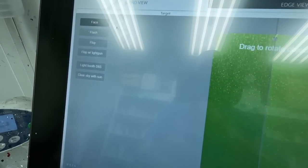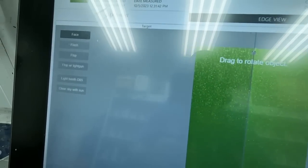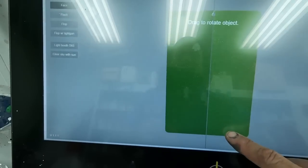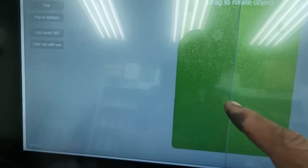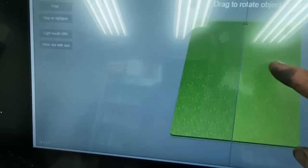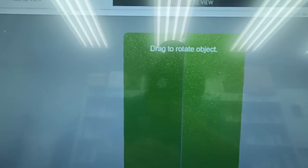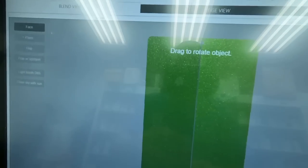So I went over to an area that I know has full coverage on it, and it did pick up PGE. This is it here, and you guys can see now we can turn it, but it's definitely lighter on the face than what we're going for. So this here is the color, and this is what they got for it that we can actually mix. We're a little bit light, and that is the 3-stage version of it. So we're gonna see whether we're gonna start out with prime. I might shoot prime on a spray out and see, or I might just go right into this one, but hang tight and I'll see where we decide to start.